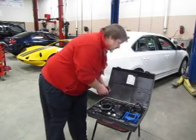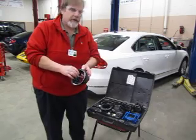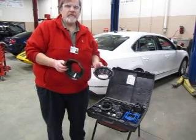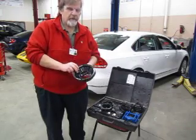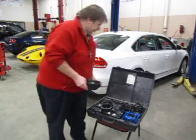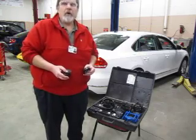And then if you have a 4 headlamp system, round, you'll use these adapters here. These are 5 3/4 inch adapters for use on round headlamps. And then these are the headlamp adapters that would be used on your large 7.5 inch combination high beam, low beam, sealed beam headlamps. On the cars that we have here, that would be on the heavy truck or our blue dump truck.